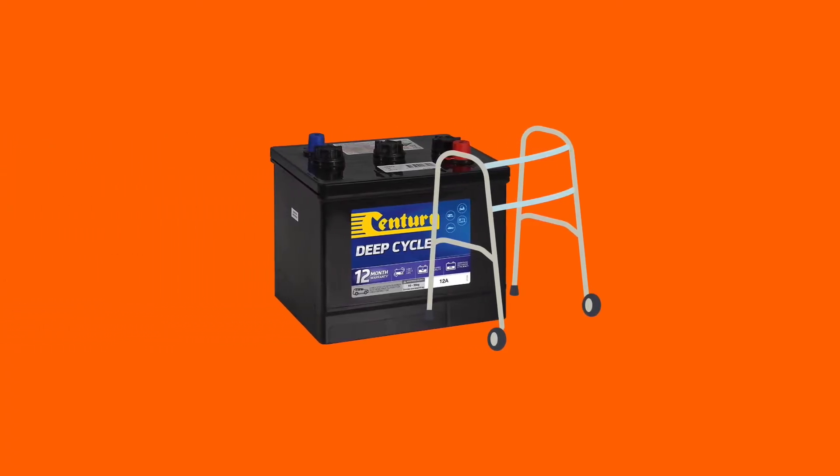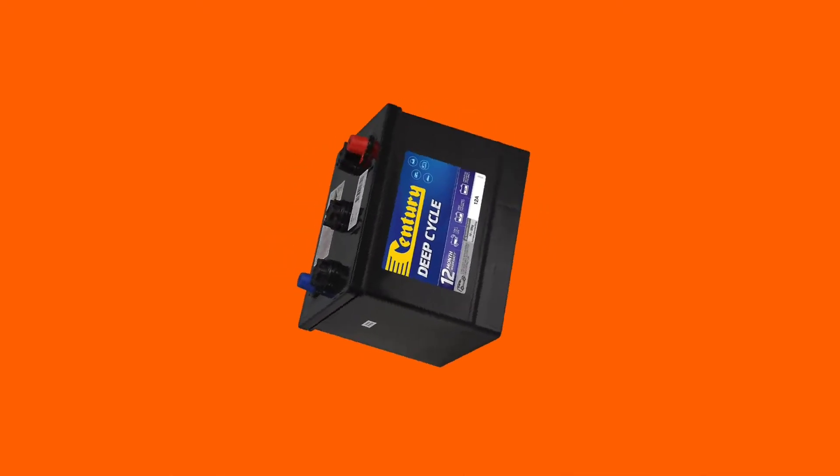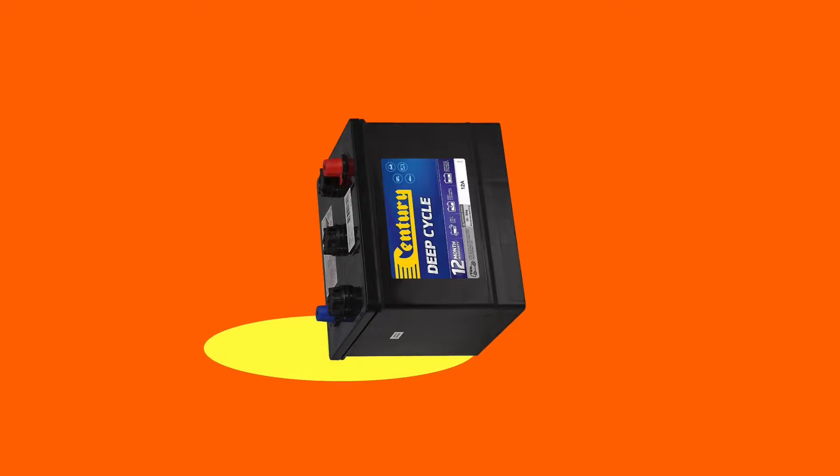Now we can finally talk about battery options, starting with your older deep cycle flooded batteries. These are your cheapest option — you can find them on older rigs, but they're getting kind of hard to come by. Flooded batteries require that once or twice a year you take a cap off the top and check the liquid level inside, and if you need to, you pour some distilled water in there to top off the levels. While this can make you feel like a mad scientist, it can be potentially dangerous because you're interacting with a container of battery acid. You also can't store these batteries on their sides because of the risk of leaking battery acid, so fitting them into a small compartment can really limit your options.